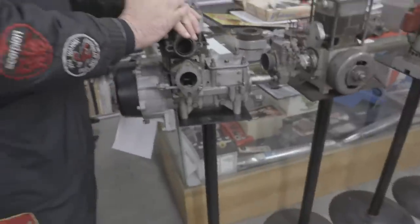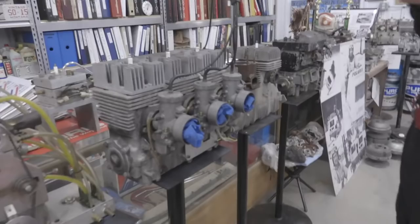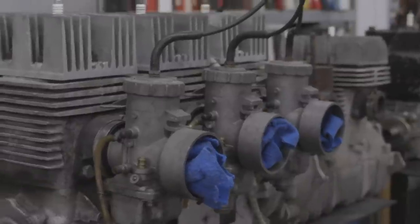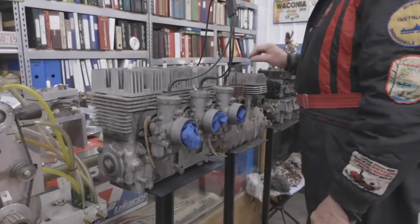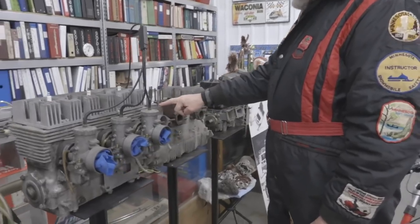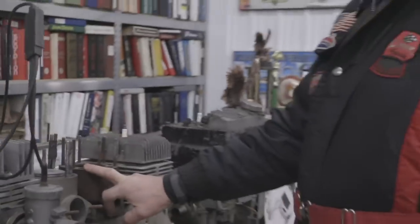He was always working on different things, and ingenuity was trying to help make more power. What happened back then, the Germans, nothing wrong with the Germans, but they wanted just regular power. They couldn't see us making so much power, and we would blow up engines, and they wanted reliability. We wanted to go faster, so we got more free air motors, more horsepower. We were up around 800 cc's, and even the speed runs were more than that. Polaris and everybody after 1975, they started making water cool. Already Arctic Cat was too, that water cooling makes the motor run cooler with more horsepower.